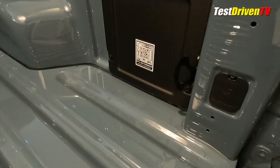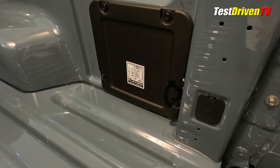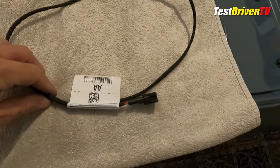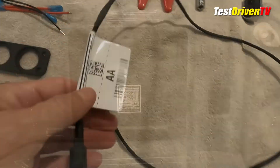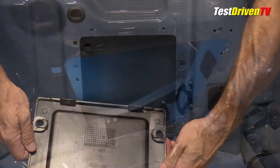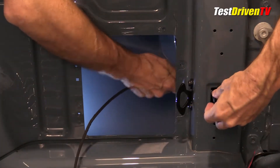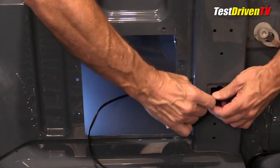We utilized the factory cover plate at the rear passenger side of the cargo box to locate the outlets and used the factory accessory 12-volt power source found right next to it. The truck came with one plug and wire set to use — you can always get more at your local dealership. Pulling the cover and stringing the wire through was relatively easy and straightforward. A hole is punched through the sheet metal allowing for an easy connection to the factory 12-volt source, which is a switched and fused source, so that part's already handled on the back end.